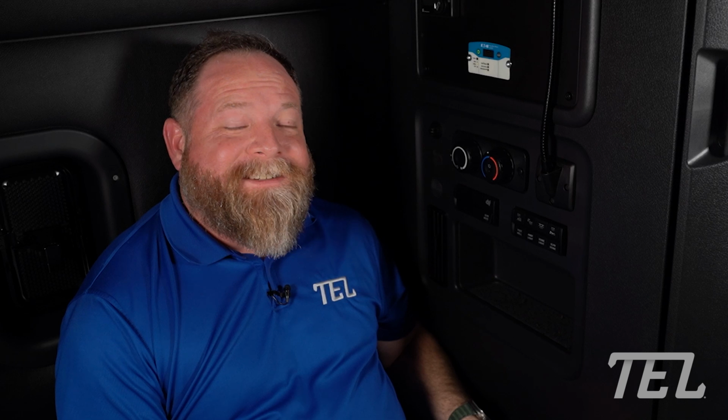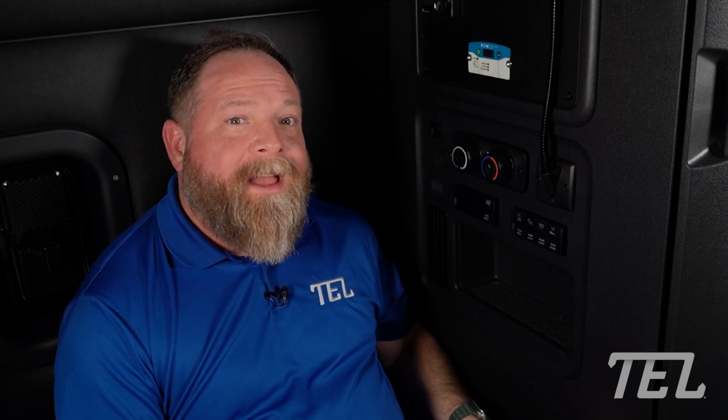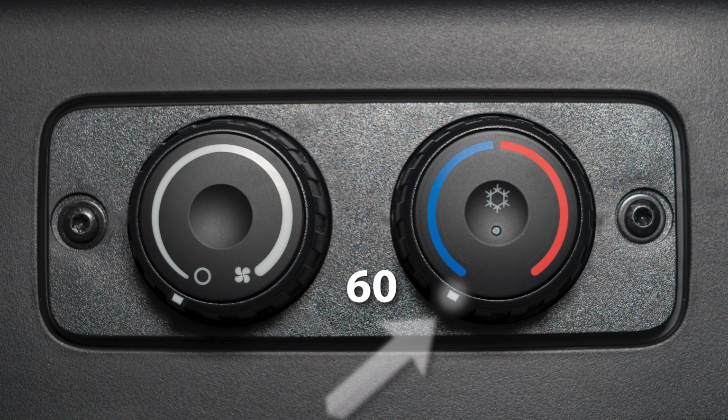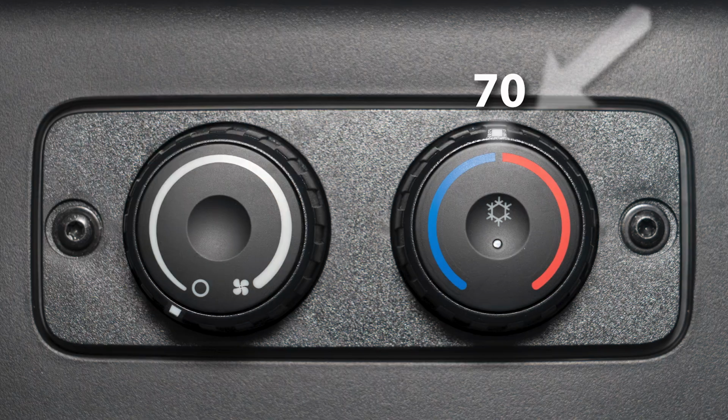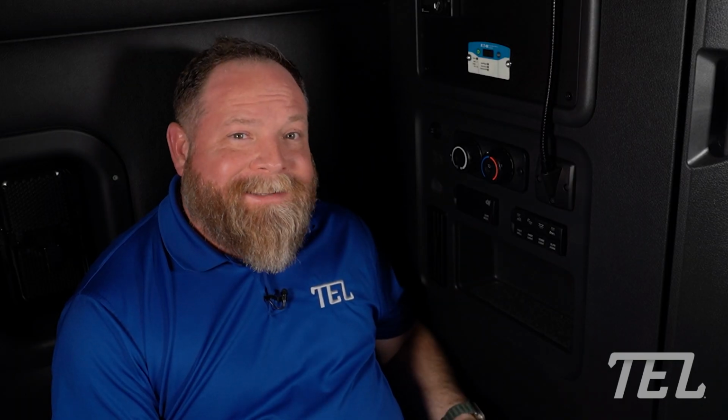While the bunk thermostat is typically used to set the desired vent output temperature, this is how we set the desired temperature for comfort control. While not shown on the dial, all the way to the left is 60 degrees, straight up and down is 70 degrees, and all the way to the right is 80 degrees. Select the desired temperature and that's it.